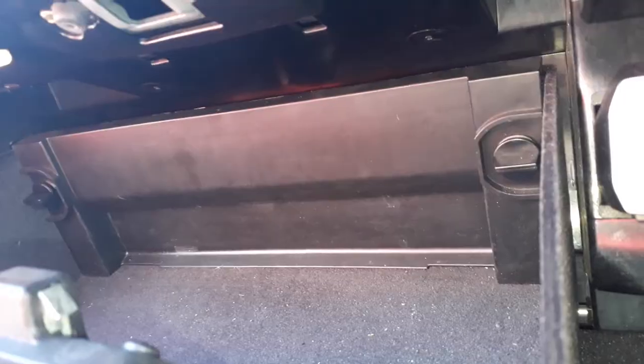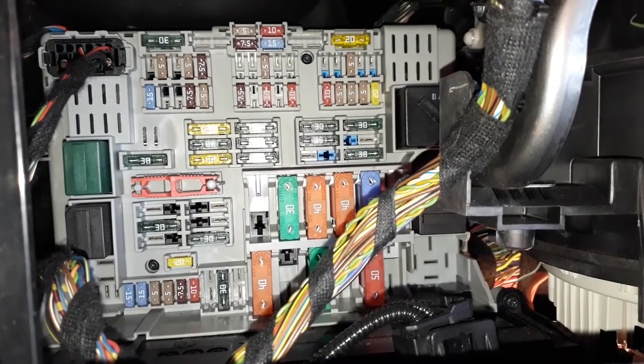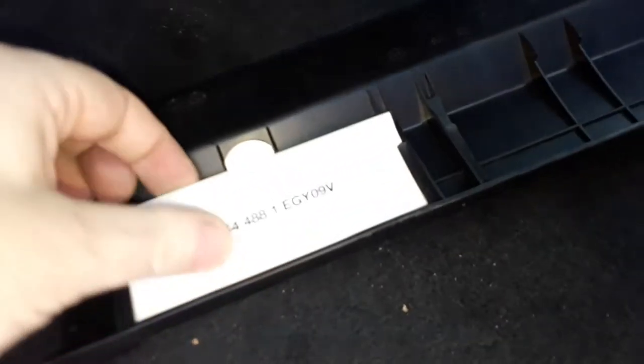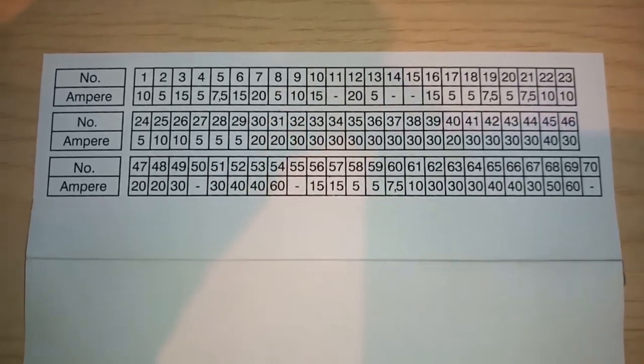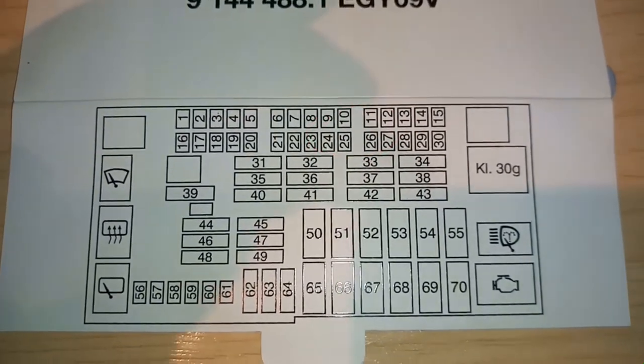To keep the seatbelt extenders out, I need to pull a fuse which is inside the glove box. We just reach inside and get to these clips and then we can drop down this panel like so. The fuse box is right at the back. Inside this panel there is a plastic piece where all the fuse locations are labelled out. The seatbelt extender fuse is located at position 25. Now this is on my car — your car might be slightly different depending on your specification.